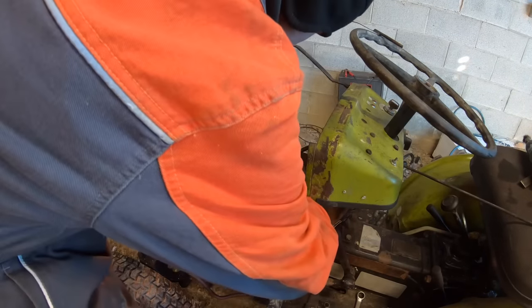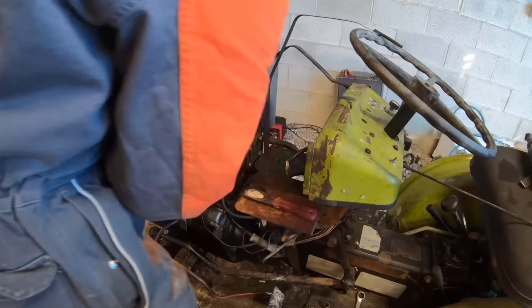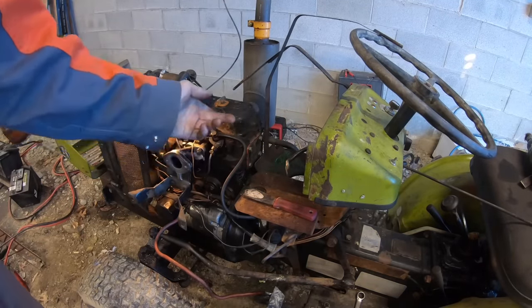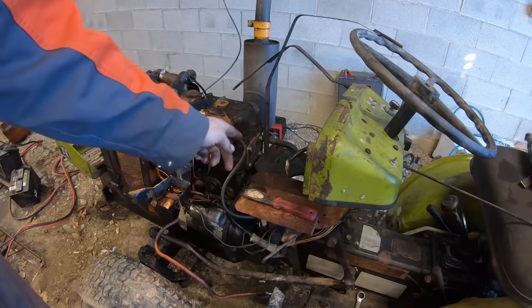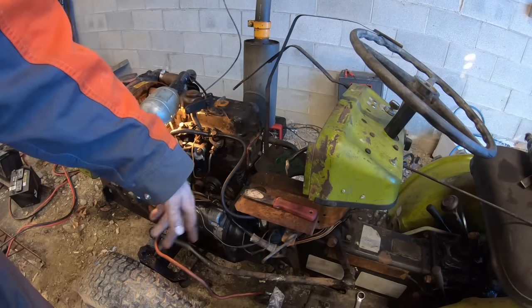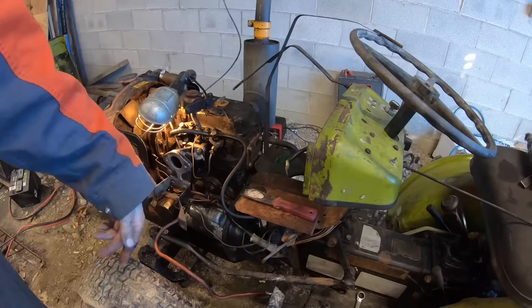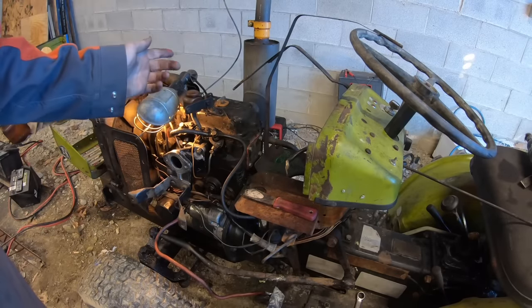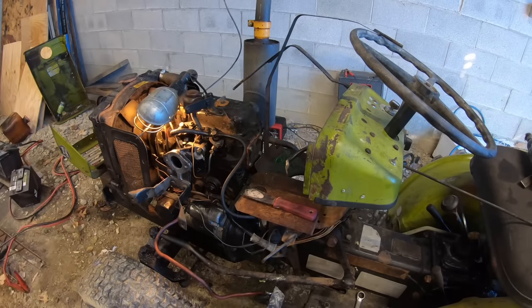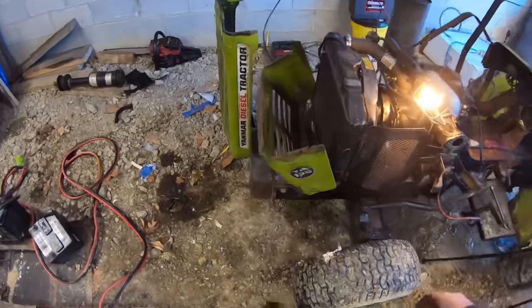I've got to get this on here. All right, so that's that. One hour gasket stuff, really? It's two hours. You gotta wait. You hand tighten it, wait an hour, and then you fully torque it, and then you gotta wait another hour before you can put fluid in it. But anyways, we'll work on something else while that's curing. And I will work on some cosmetics.